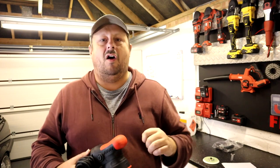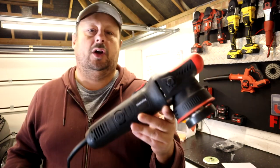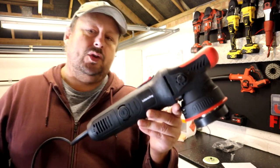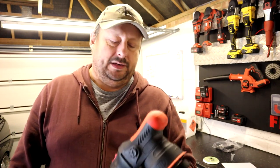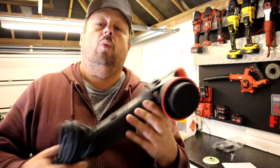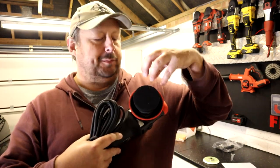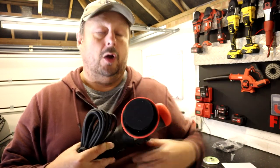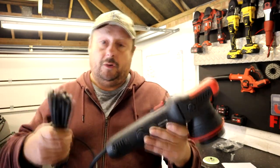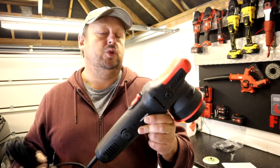Today's video we're looking at what I sometimes refer to as budget polishers, starting polishers, entry-level polishers. It's the price point. This polisher here is called the DA8 from Interdetailing. The '8' stands for the offset — the free-spinning bearing offset on the main axle, called the orbit or throw. It has an 8mm throw. You get long-throw machines with 12mm, 15mm, or 21mm offset. This has an 8mm offset and a 900-watt motor, and it costs £100.